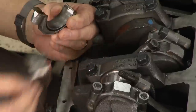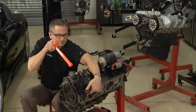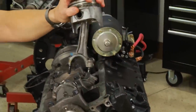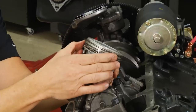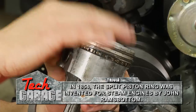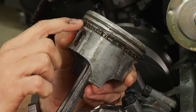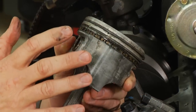Our diagnosis will tell us what's going on with that a little bit later. Now let me knock this piston out. There we go — now you can see the rings. These are the piston rings. When that piston went up and down, it's keeping the compression inside the cylinders. During that power stroke and compression stroke, when it explodes, we can't let any blow-by go past these rings. This one right here is an oil control ring — that's going to keep oil from going up in there and possibly causing your engine to smoke.